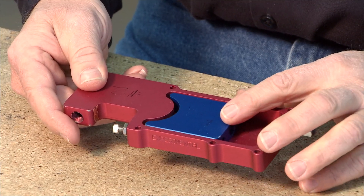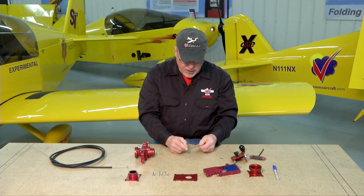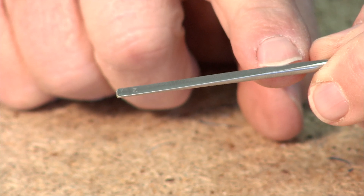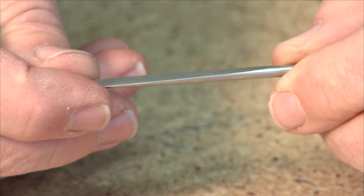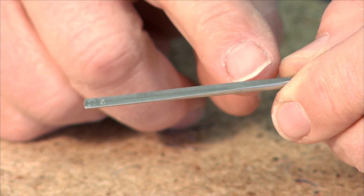Once you get that set up, then you're going to want to check what it does at the low end at your idle. It may be too rich or too lean, and you can adjust that by changing the needle itself. Remembering that the needles are numbered — higher-number needles have a steeper taper — if you're okay at the top end but you're too rich at the bottom end, you're actually going to want to go to a richer needle, a higher number. That'll allow more fuel at the upper end but cut back the amount of fuel at the idle end. If you're good at the top end but too lean at the bottom end, you'll actually need a leaner needle. Always start after you change needles by setting the high RPM setting first, get your full throttle setting correct with proper static RPM and proper EGT rise, then go back and check your low end.